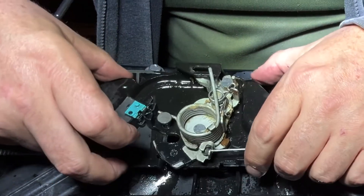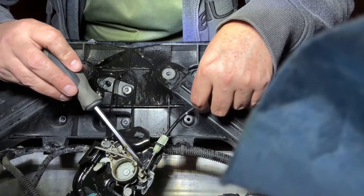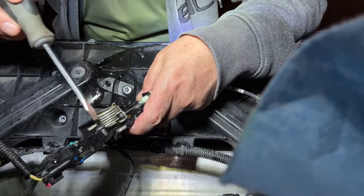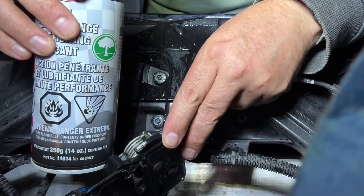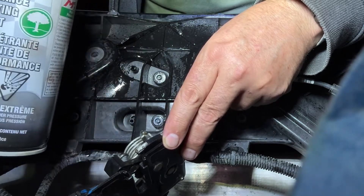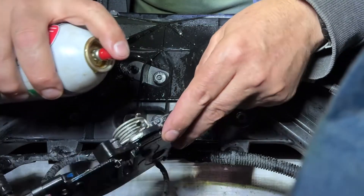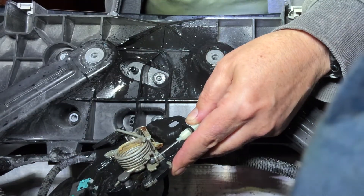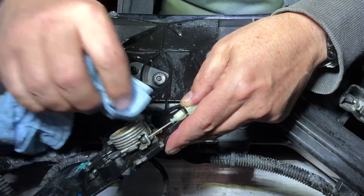This mechanism here was a little bit frozen, so I'm going to show you what I did to fix that. First, let me open the mechanism up. What you saw was this cable getting pulled on — that's actually opening this whole mechanism here. What I found was this mechanism was not moving back and forth freely, so let's clean that up. This is a penetrating lubricant. You really want to avoid just using this because it's really lightweight — it's good for freeing it up and cleaning it, but it's not good for lubricating. We're going to spray a little bit on the spring, avoiding the sensor, then take a shop towel and clean this up, including the cable end.